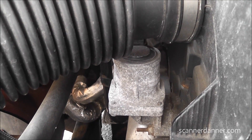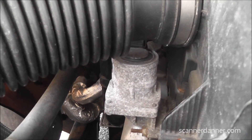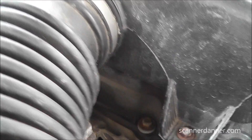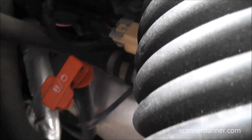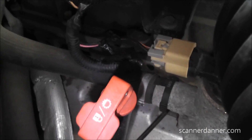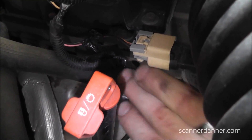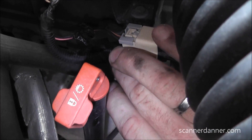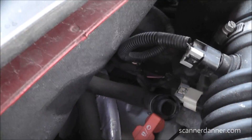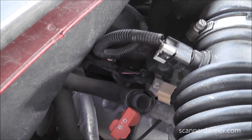I've already ruled out the pump itself and its controls because we can hear it turn on. What we want to do is check for flow. So I'm going to turn the pump back on and reach down to the tube coming through here - it's a squeeze-type fitting - and pop this tube off. Take a listen to it. You can hear it's got some really nice flow when disconnected. Now I'll plug that back in and let you listen.